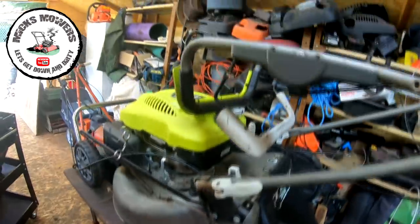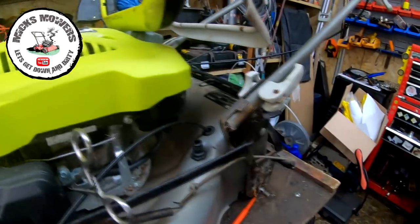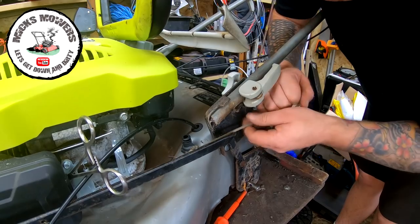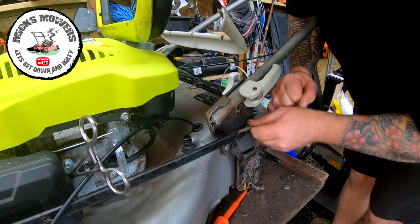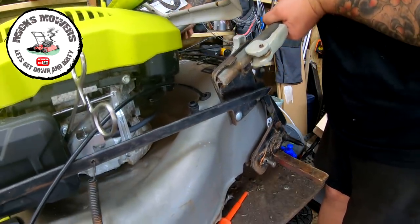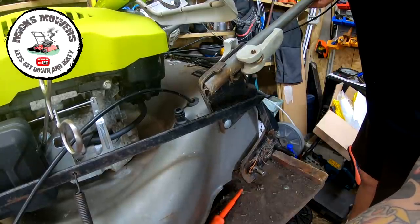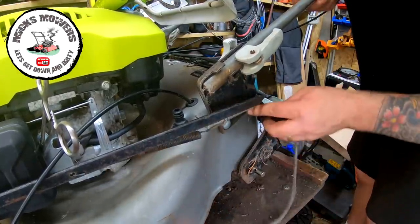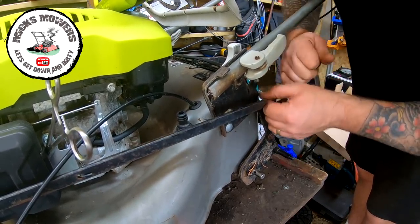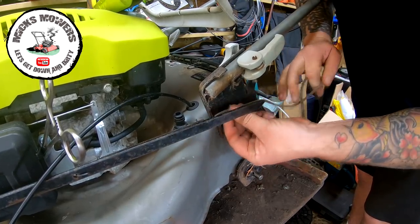Let me move you guys round so you can see what I'm doing and you're not in my way. Just put you down here and hopefully you'll see this, if it doesn't all come off and bite me in the chops. That spring's got a hell of a travel. Let's try and minimise it by bringing that back. Select the height adjustment up to the highest level, and that way you've got less travel to put on it. And there's a hole where it is there. That's going to come back and sit in the hole just there.